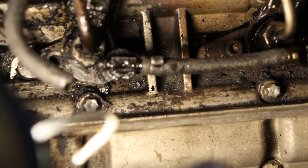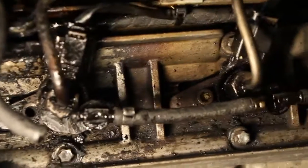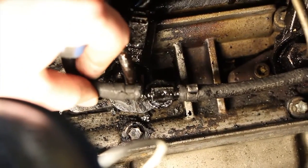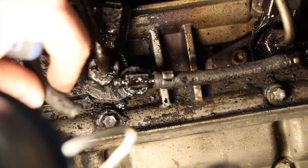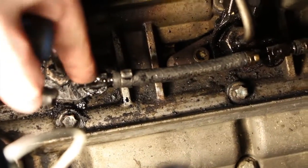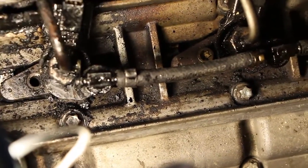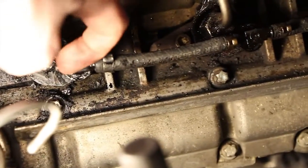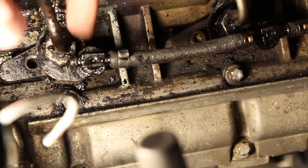The bolt came out no problem with the engine warm. Unfortunately, I broke the little nipple connector there - that's where I was unlucky. The piece that broke is part of the fuel injector return line, which is also called the leak oil line. Although it's fairly expensive, in the end I'm glad I replaced the entire line. But more on that in a second.